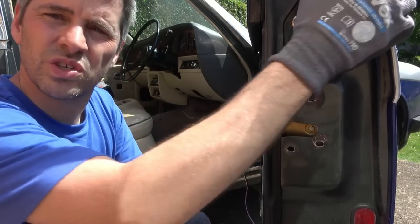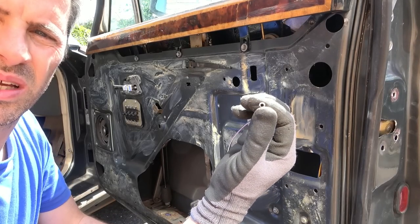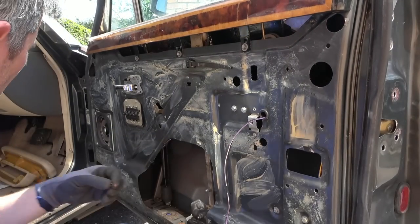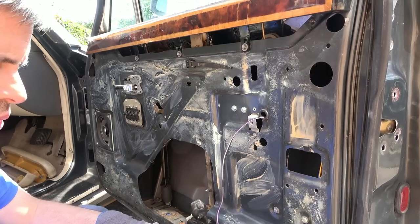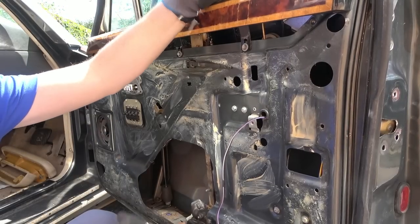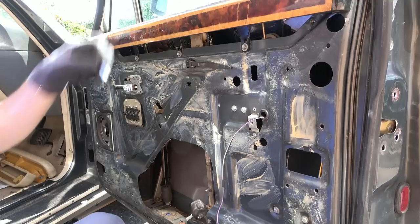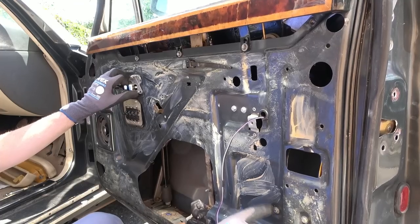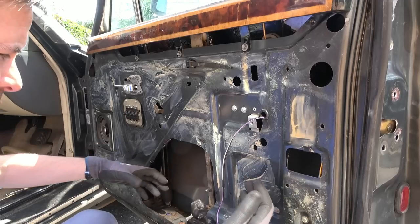Do you know what? Undoing that, unfortunately, hasn't really helped me. Well, I've been just fiddling around here and this dropped out like a little collet, and it's actually come off that bar that I'm talking about from the pressing the button there. Do you know what I think? I think I'm going to have to take out the whole kind of locking mechanism. So I presume this is going to unscrew. We already know that from the one that's missing up there. Is it going to unscrew? Hold on. Yes, that unscrews there. I think if I was to undo these three bolts here, undo this bolt, this bolt, this bolt, maybe I can work its way out